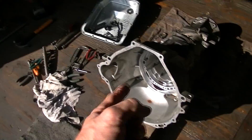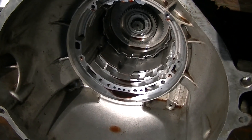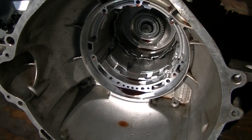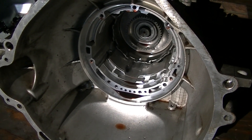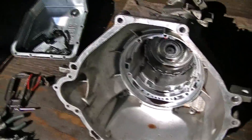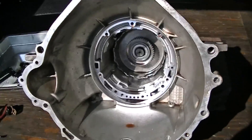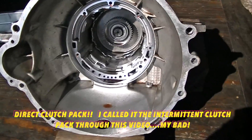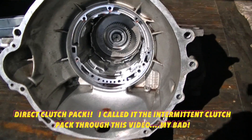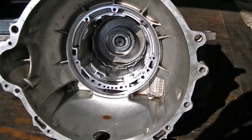What I'm going to do — the purpose of showing you this right now — I'm going to pull the intermediate clutches back out of there, the clutch pack, and show you the seals and everything. I didn't get to show it in the second video because I kind of got ahead of myself and stuck it back together without making a video of that clutch pack. I figured I'd pull this back out real quick and take it apart and show you guys. It won't take very long.